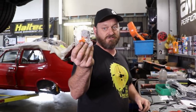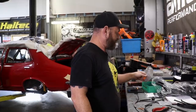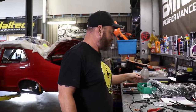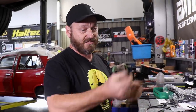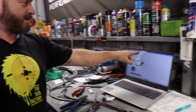We generally use Deutsch connectors — Amphenol Deutsch, whatever you want to call it. Genuine Deutsch is best to use but the cost is there — it's not the cheapest thing in the world. It is probably the best without going stupid with racing car stuff. Haltech uses those on all the CAN connectors and everything — all Deutsch connectors. They are a good thing, they're easy to use, and easy to swap pins around if you mess something up. Plenty of info on the internet, just got to go looking. This is Haltech's support page — it has all the details right down to how you just connect that to the yellow wire and you'll be sweet.